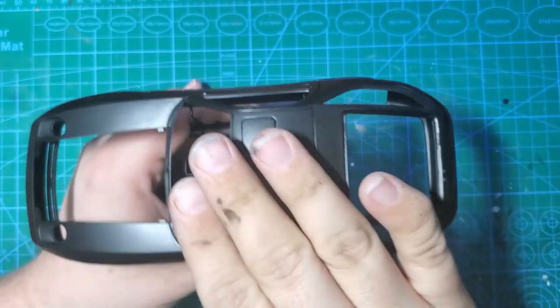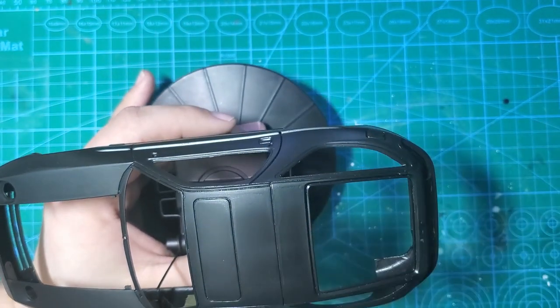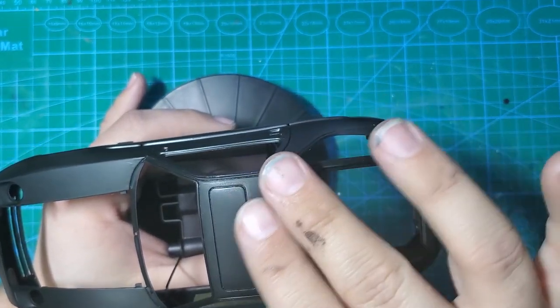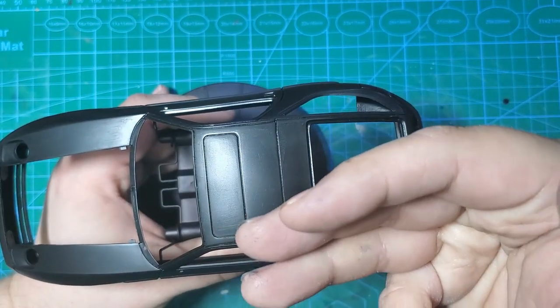What you do want to do is cut through that 2K, because the 2K is very resistant to stripping. If you can get under several areas where you can get under the 2K and really weaken that paint a bit, the stripper can get under and get to that primer.